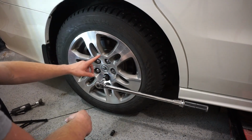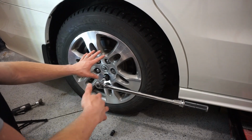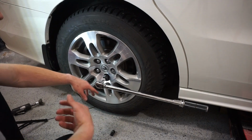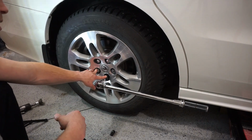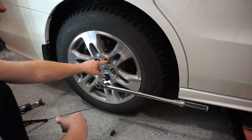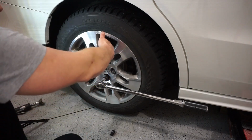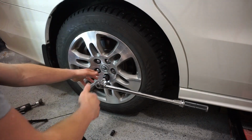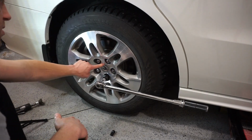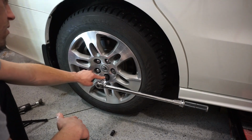It's gonna make sure that you're torqued on properly and that your tire isn't going to be flying down the road on the highway because you had these nuts higher. And somehow once you came around this way, this one's super loose, or these loosened up because the wheel was cocked somehow. So doing the star position is what I recommend and what all the professionals use. Sorry, I did that wrong.